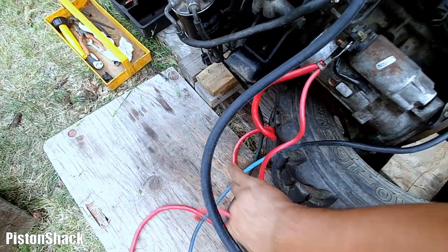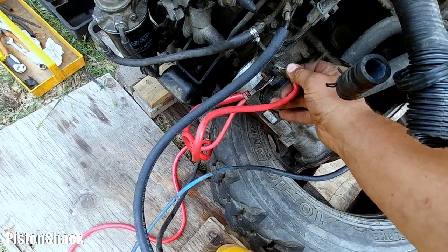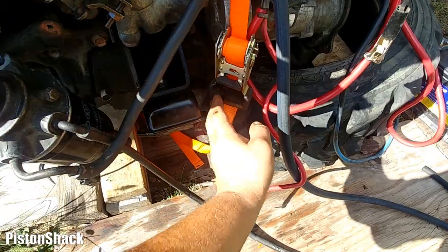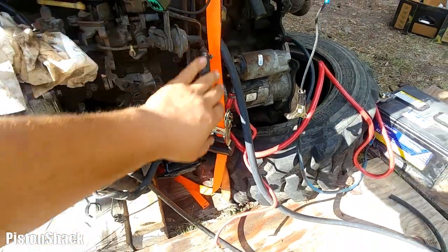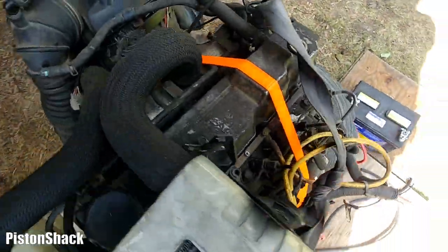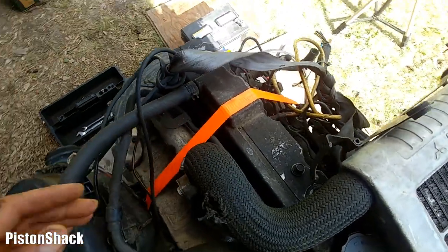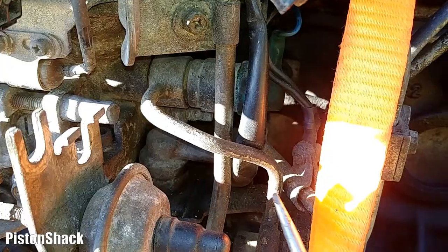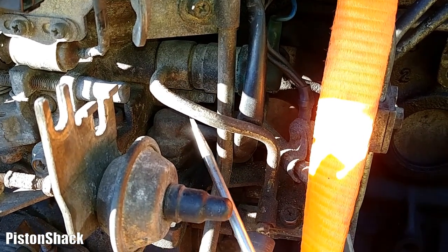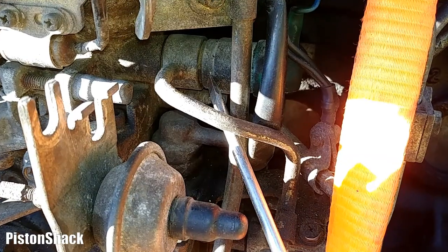This positive cable is from a Volvo XC70 — it has another cable crimped to the main cable end. Let's put a strap to secure our engine, make sure it won't run away and everything's safe — safety first. Now let's supply power to the fuel supply solenoid. We need those coils energized and the plunger to move to get fuel to the injection pump.